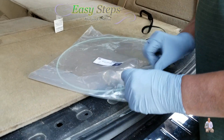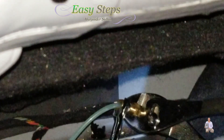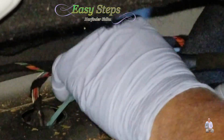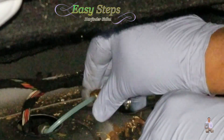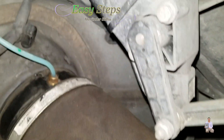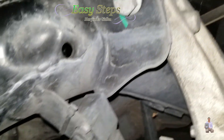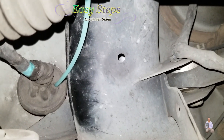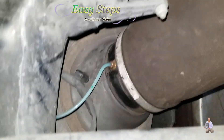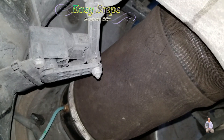This is the one we need to open — this is the OEM part. We're going to get a plier, put it right in the middle, then open it. Once it's open, we're going to come down. This is the tubing on the air bag — it's been routed right there, coming down, going inside the trunk. That's where I opened it. I'm going to open from the air bag and replace this tubing, because I can hear the air leak from this side.